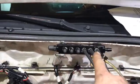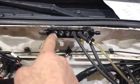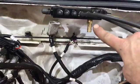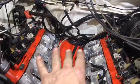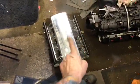Now, this is all for vacuum stuff. Then, what I did is I took that vacuum block off, and I'm going to come from the bottom of the intake, it's going to come up and go into there, and then I'll put my MAP sensor on this side on a piece of hose. And then that big one, I drilled and tapped the bottom of it, and I installed that. That's 1/2 inch, and that's going to go to my brake booster. So that's where I'm at right now. I got the 2 ground wires for the Holley installed in the back, so I'm done back there. There's nothing else that needs to be done there. So I am going to take the injector harness and adapters off of that one, put it on that one, and then we're going to install this intake.